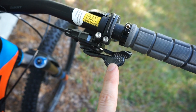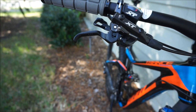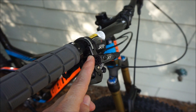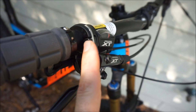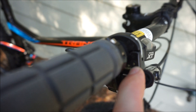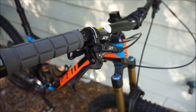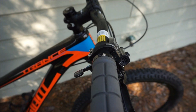For example, it's got texture on the shifters and inside the brake levers, which is really nice. Also, you can get the levers off the bike without removing the grips — you loosen the bolt, and there's a little 'push to open' mechanism. If you want to completely release the brake lever, you push a small allen wrench into the port and it releases the top mechanism, letting you pull the lever completely off the bike without removing the grip. Just another little detail Shimano keeps improving on.